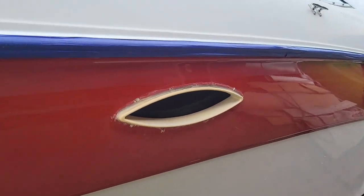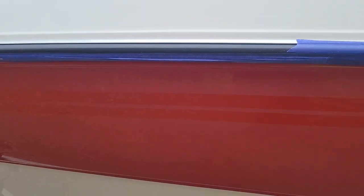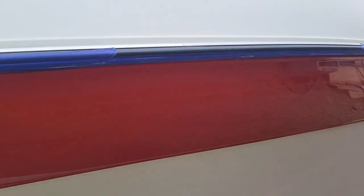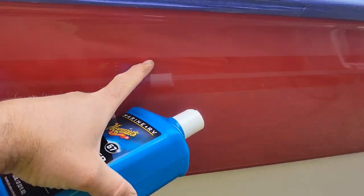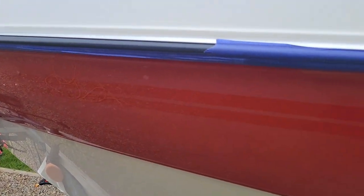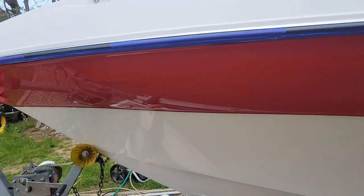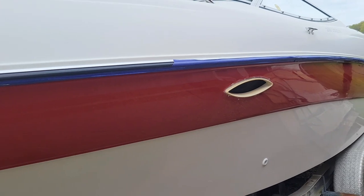We've been working with the Meguiar's 49 and it's doing an okay job — you can kind of see where I stopped. I'm moving on now to the Meguiar's 67. It's definitely shinier but you can still see the details from the old decals and there is still some hazy oxidation. The next step after this is Meguiar's 91 heavy cut, which is on order. This seems like an advertisement for Meguiar's since I'm using all their products, but I assure you this is not sponsored — although it'd be nice.